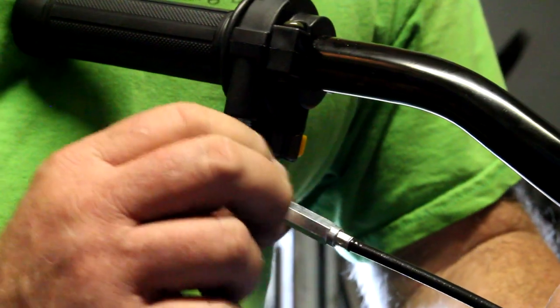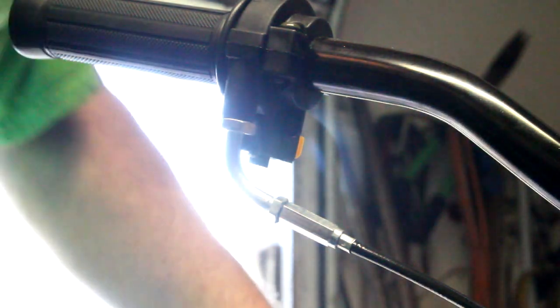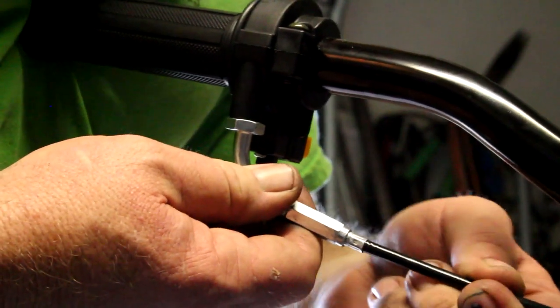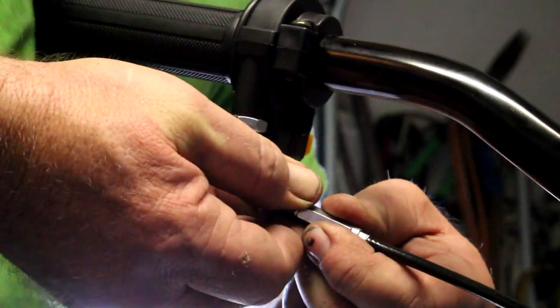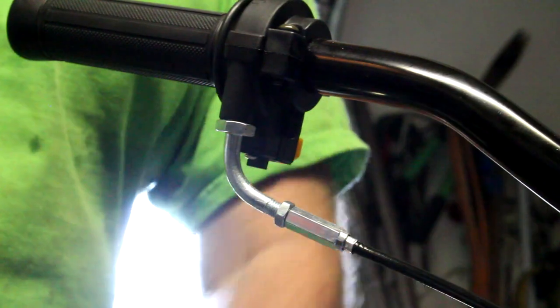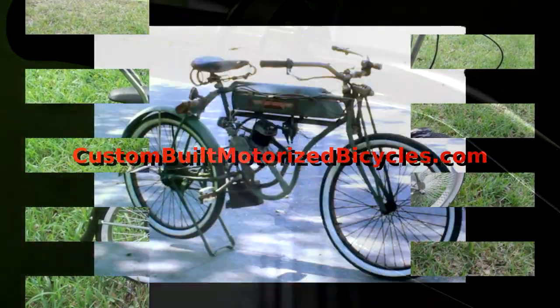The jam nut came loose, so aim the cable towards the center of the bike, hand-tighten the jam nut, then take a crescent wrench and give it just a little turn. This is a plastic housing — you don't want to get it too tight or you can crack it. Now there's a little slack in the cable, and that's what the cable adjuster is for — unscrew it until the cable doesn't move anymore and tighten it up. Come back with a 10mm wrench and a crescent wrench to get it tight. Hope you enjoyed the video — give a thumbs up, click subscribe, and check the link below to find where you can buy a throttle housing and cable if you need it.